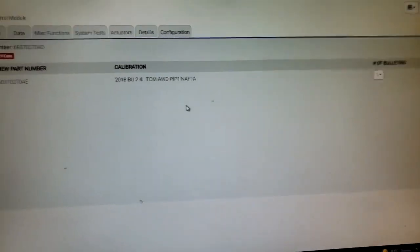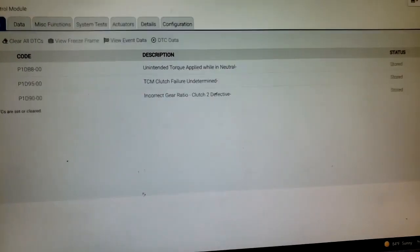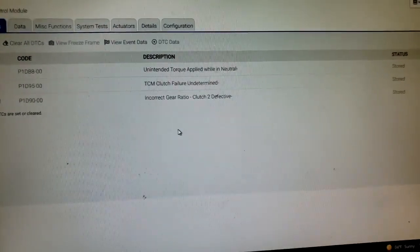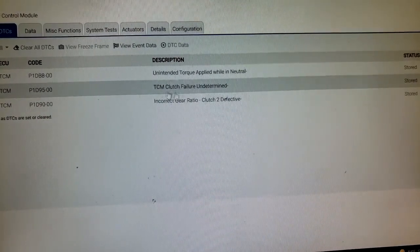What I want to say is, I simply want to agree that being low on fluid caused those 3 fault codes. All right, guys, I'm going to put those fault codes in the description. So that is the reason why the check engine light was on. Technically, I don't think there's anything wrong with the trans. I think because it was low, that's what triggered those gear ratio error codes.